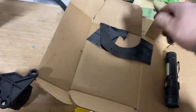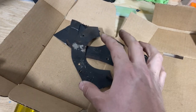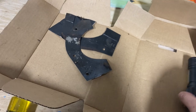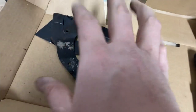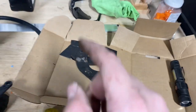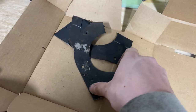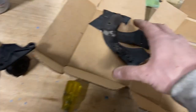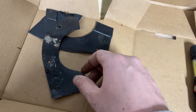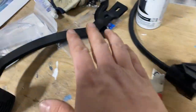Change of plan — scrap that, it's not going to fit right anyway and you won't have enough holes. Go ahead and make yourself a cardboard template, then trace that over to aluminum or some stamp steel and just throw that in there. Another thing I wish they'd do: you're buying this whole kit, so sell the rubber gasket or at least a stencil to cut one from — because if your car is a '60-something, that gasket is shot by now. Anyway, we're going to jump ahead and install the clutch pedal.